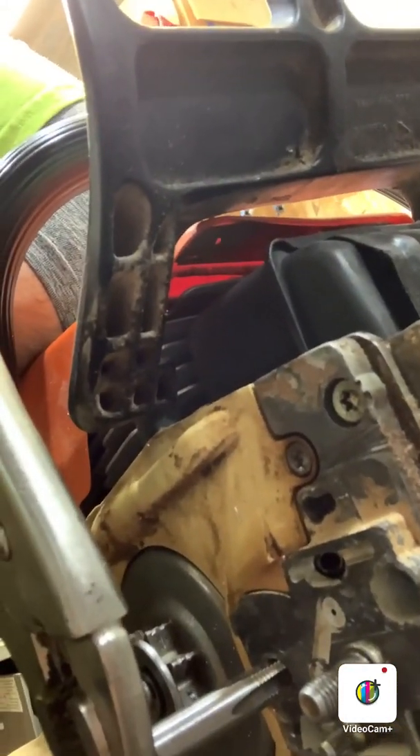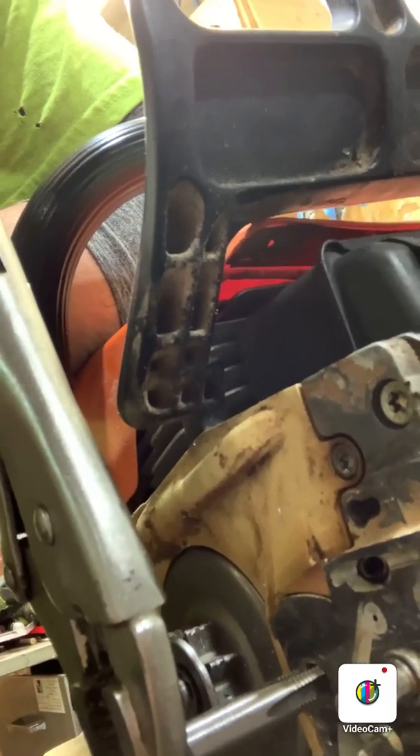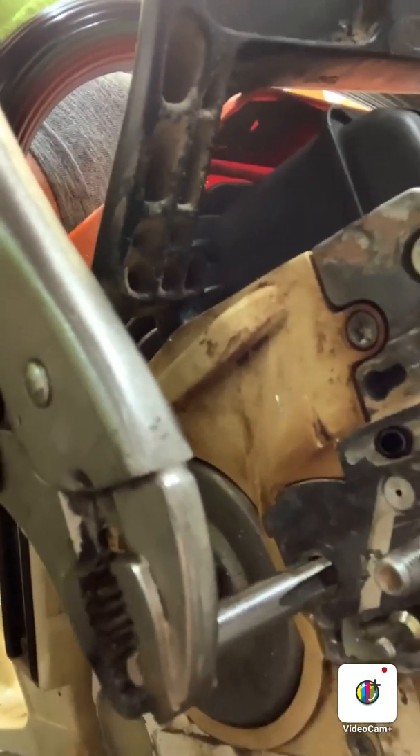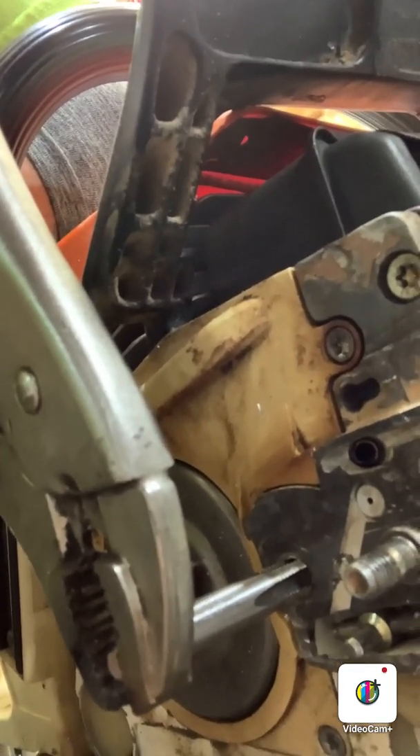When we had the nut on there, we couldn't take the nut out because it was stripped inside the case. So I got it drilled and now I'm just tapping it out. I will put a helicoil in it. Steel does make oversized studs I guess, but I talked to the guys at the dealership and they thought it's better to put a helicoil in it.